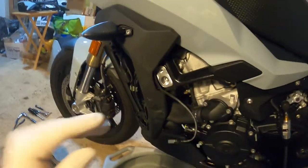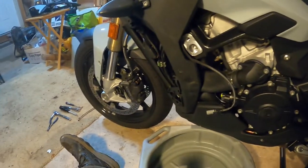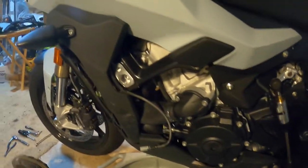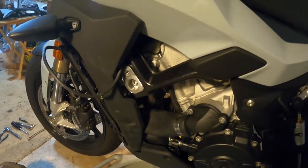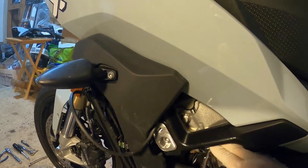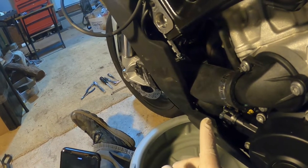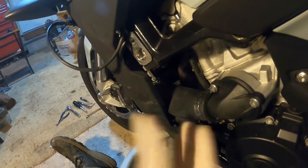All right, I'm gonna put the cell phone over there so I can see what you see. Hopefully we won't have to remove this panel, because if I do I have to remove the other side too. Now this is why — look how flat that hose is, it's releasing right now. This hose is not actually pulling fluid from the coolant reservoir; it's just creating a vacuum and sucking shut.